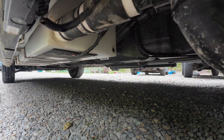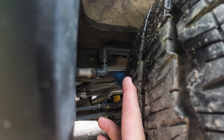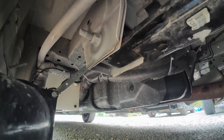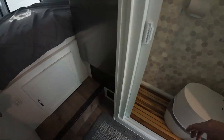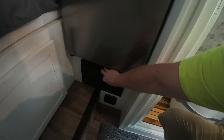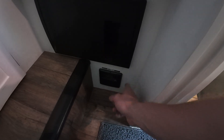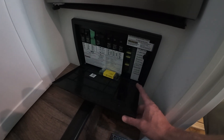It's pretty easy — I just need to run a wire. I have a gray water line that comes out right under the van, so I'll have the wire come out along that gray water line and zip tie them together up to where we need to mount it. Inside, this is where my power center is — and that pipe goes out back here too — so I figured I'd mount the switch right down here next to the power center. I have an opening where I can reach down and flip the switch. It's convenient to get power off of a circuit we already have, or I can add one just for that.